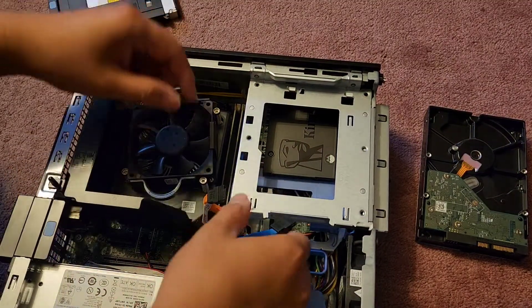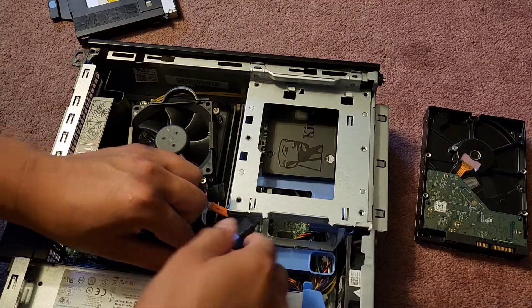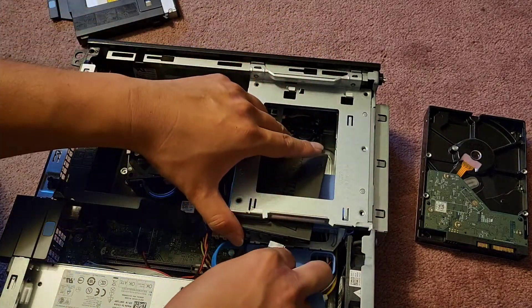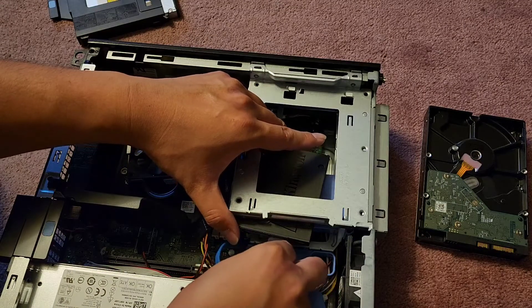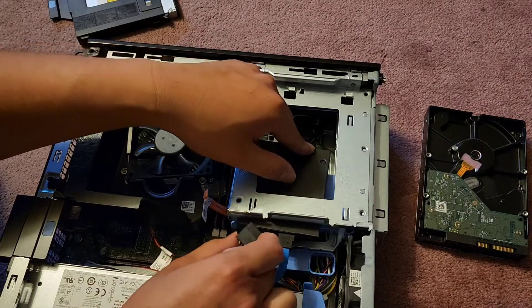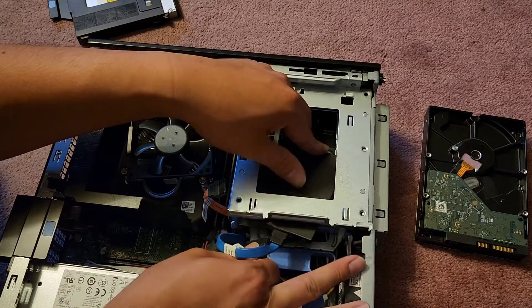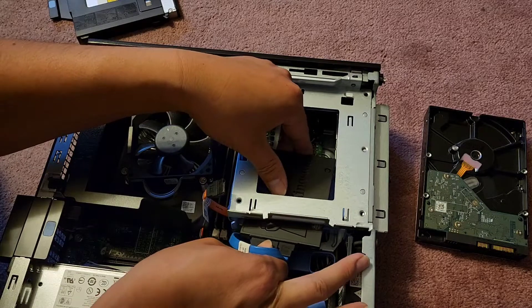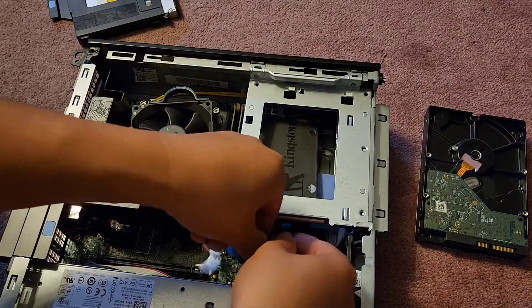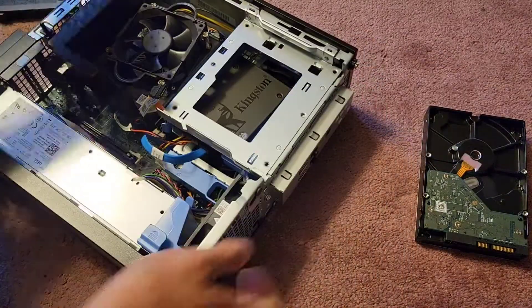I'm back — sorry about that. Let's go ahead and reconnect the hard drive. We did put this in — you can pull this blue latch back to lock it in. The hard part is trying to get the cables connected in this awkward position. You can actually have it slotting out slightly, which makes it easier. Then we'll get the other cable and tuck this underneath to make it a little easier — get that into place. Now we're going to get this front bracket back.